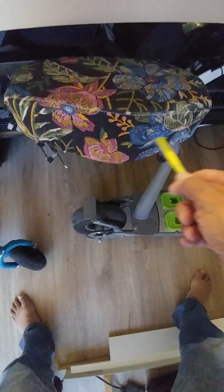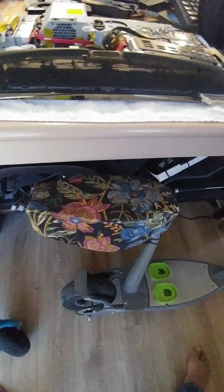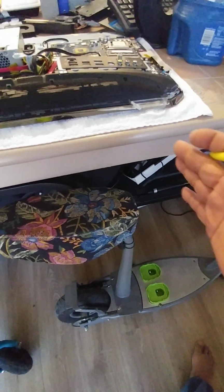It's a little bit further because I turned it 180 degrees, and I also moved this back. So I'm actually sitting directly in line with this wheel almost. So the center of the seat is about right there. So it is a little bit too far back. So when I ride this, I have to make sure that I lean my body a little bit forward, to move the center of mass more in line with the center of the scooter, so I don't pop a wheel. When I sit here, and if I give it throttle, it'll want to pop the front wheel up.